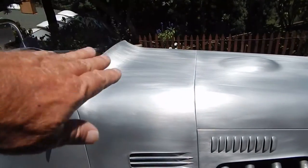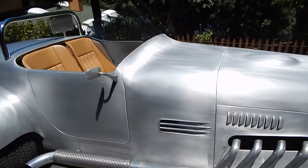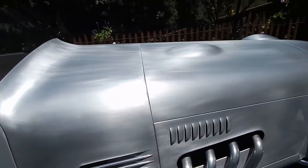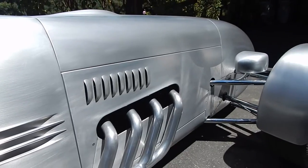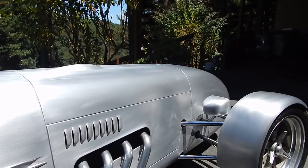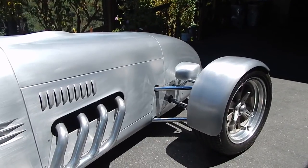The way the cowl flows — this whole tail piece is removable; we'll talk about that more. It's got some louvers in the side here to let the hood breathe a little bit. One of the things about the car is the full underbelly — the whole chassis is covered except for some openings for air. You need openings underneath to let the air out. The engine and transmission area just gets too hot for a car like this.